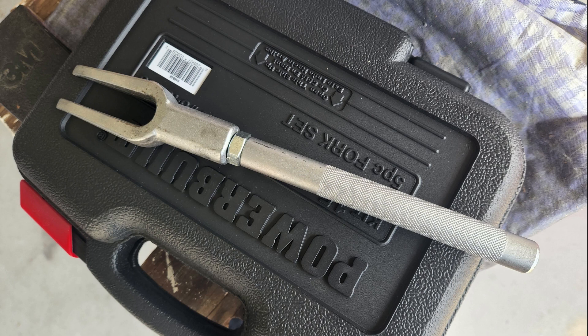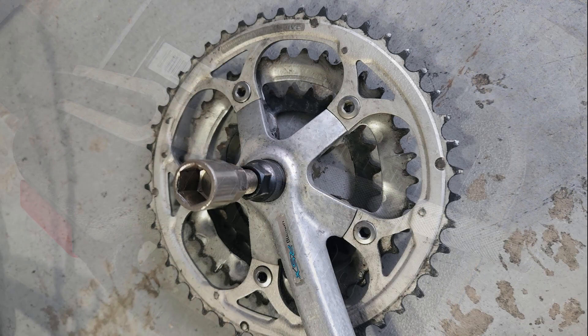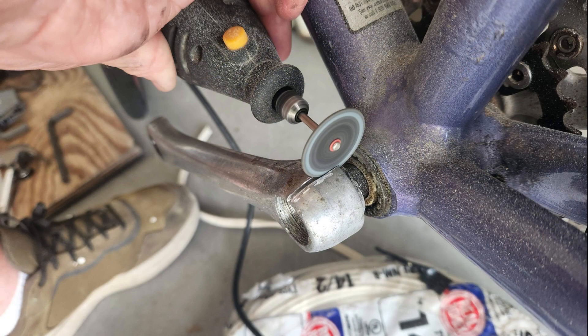I've ridden it about a thousand kilometers last summer and I'm just visiting my folks here in Florida — this is the bike I ride. I wanted to get the crank off because it's got a 46/36/24 triple on the drive side and that's just not cutting it on flat Florida. I wanted at least a 50-tooth ring. So I said let's just take out the Dremel. I don't have a grinder and didn't want to go rent one, so let's just see what happens using the Dremel tool with the proper metal cutting disc.